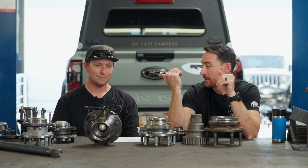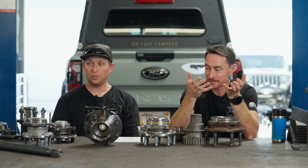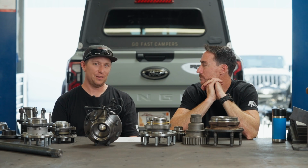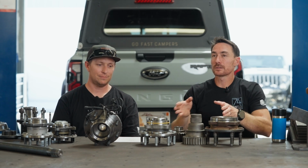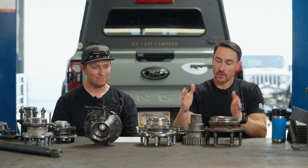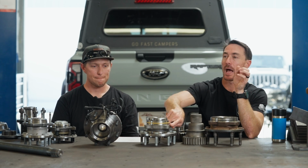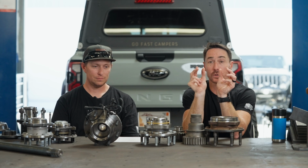And then explain statistical analysis on bearing preloads. It's just that they tolerance it such that there's going to be a certain percentage that will fall within that range, and it's going to be very, very high. So what he means, I guess, where you should add clarification there is that they know that these bearings need to be, you have opposing tapered rollers inside of this pack. They know that the distance apart needs to fall within a certain range.